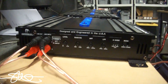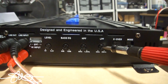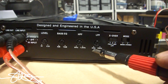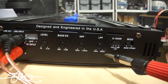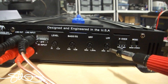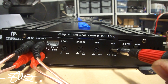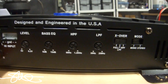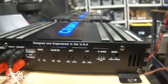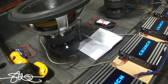Here's the next thing that the CC1 does. These are bass amps, so I'm going to choose low pass. But I've got a 30 hertz dot and I've got a 250 hertz dot. Let's say I wanted this amp to be tuned to around 80 hertz and below — I'll just turn it and guess where it's at. Maybe somewhere around there — that could be 80, that could be 60. I have no idea what that is. So the next job of the crossover calibrator is to calibrate the crossovers.